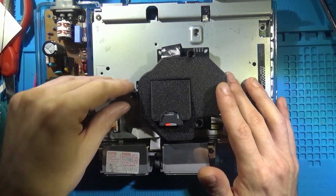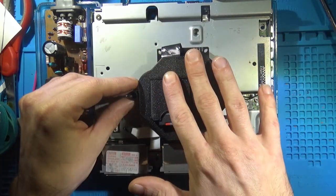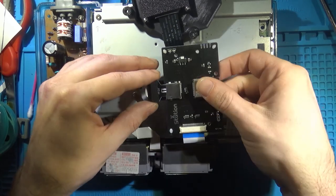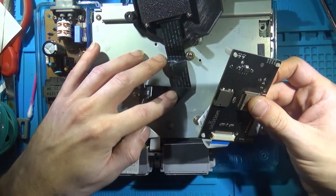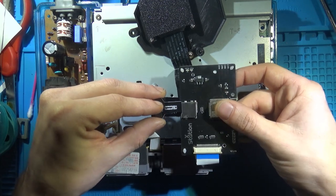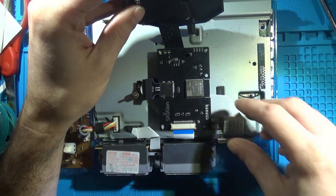Okay, and just real quick, I want to go over the folds here for the ribbon cable on the SD card mount from LaserBear. So it's plugged in, and here's what we got here. Just one hard fold angled like this. You want it to be routed underneath the Xstation. Otherwise, you're going to have a lot of forward pressure coming up. You want it sitting flush in here before you go ahead and lock the top in.